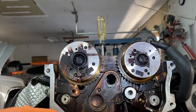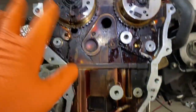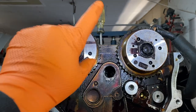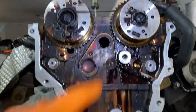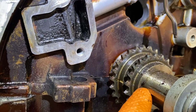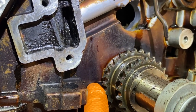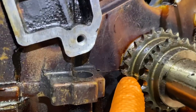If you have the chain on — it all depends. If you're putting it all back together you're going to have to do it the way I'm saying. So top dead center on compression stroke. The crankshaft keyway is going to be right at the bearing cap on the bottom, and the line — the mark — right here. That's important.